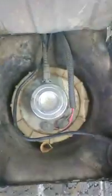You've got to unplug this harness, pull it out, and that's your fuel pump plug-in. That's for your power. I don't know much, but that's the power of the fuel pump. You unplug that, you pull the line through, you get your new fuel pump. And when you get your new fuel pump, you unscrew this whole ring right here, and the whole assembly just comes straight up.